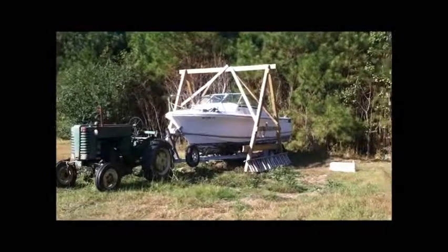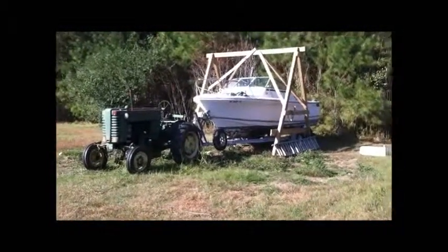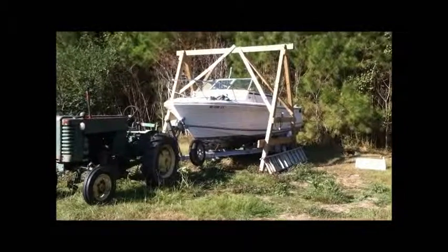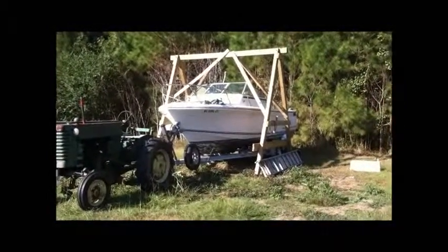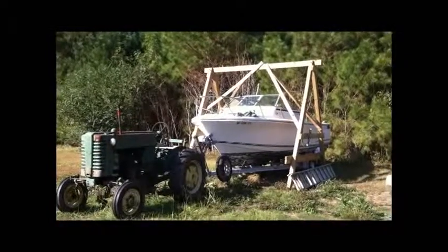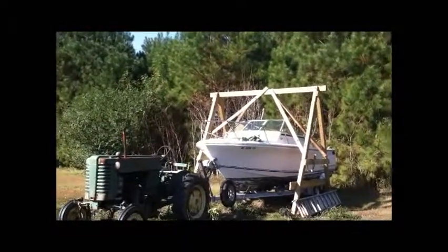You heard the rooster — it's time to get up and work on the project. I got the boat under the a-frame last night. I took some video but it was kind of dark. I've taken the engine off the a-frame and backed the boat up under there. I did look up on the internet what that four by six beam could hold. If it spans five feet it can hold like eighteen hundred pounds, and the further you span the less it can hold. On a twelve-foot span it looks like you could lift roughly eleven hundred pounds right in the middle before it would break — another source said 882.